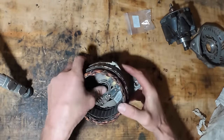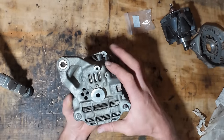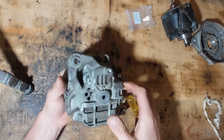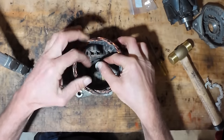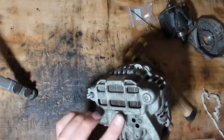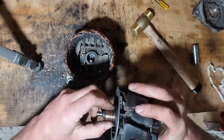I'll push that bearing in there first of all, and I've got to get it past the carbon brushes. So come in from this end and poke it out of the way. Quite handy having that hole there actually — just got to be careful not to damage those brushes. That's right at the base of the housing. Put the rotor in there now. I'll just give that a quick touch up with sandpaper.